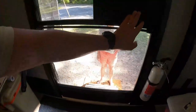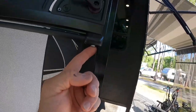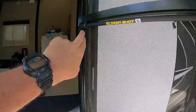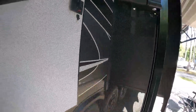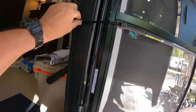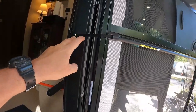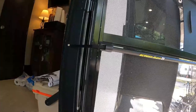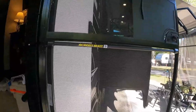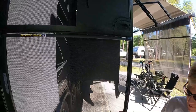It's real simple — put this in that slot right there, put your screw in, slide this one up in the channel, put your screw in the closest channel to the screen. Half inch off your door jamb — run that through. I used a pilot hole first, then a 7/64 bit, and there you have it — the screen door closer is installed, ready to rock and roll. Let's wrap this video up — shout out to Lippert Components, by the way, they made this door. LCI, yes!